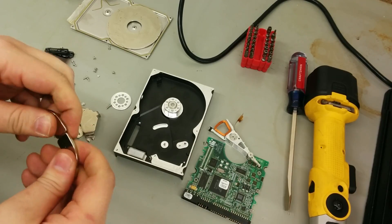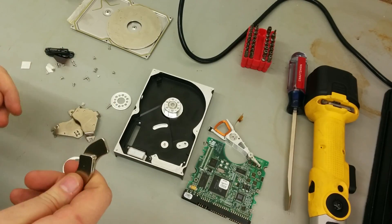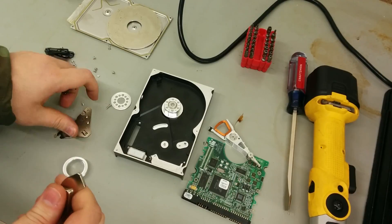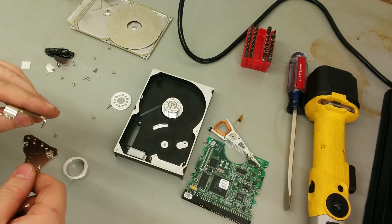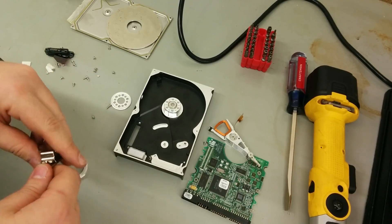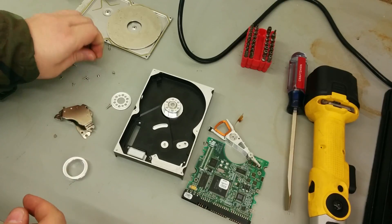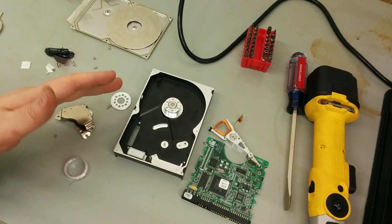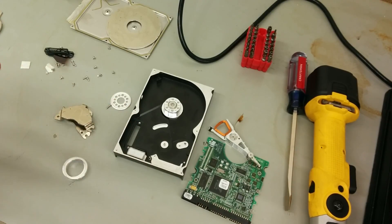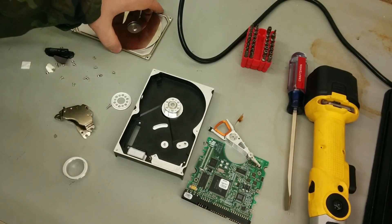They make fantastic fridge magnets or anything kind of useful for that. There are two of them in every hard drive. They're a little hard to get to because they are usually glued to these steel plates, and in the hard drive enclosure there's usually a whole pile of Torx screws. In my early days when I tore apart these old hard drives I didn't have Torx bits, so I just usually took them to the drill press and drilled out the screw heads.